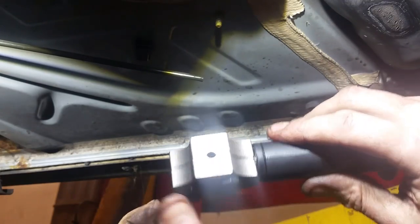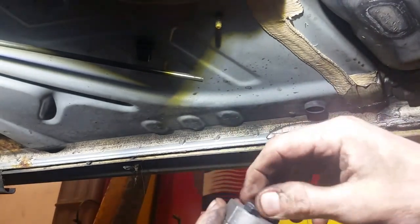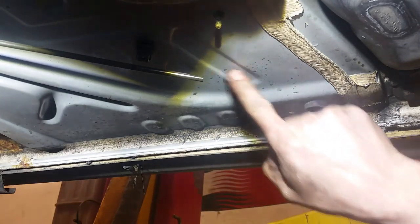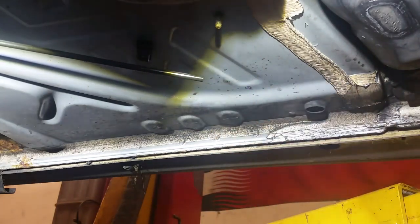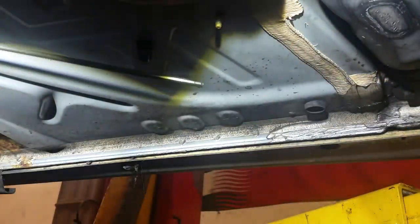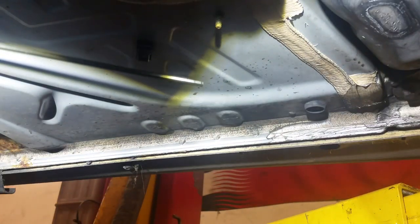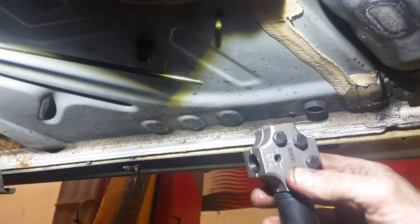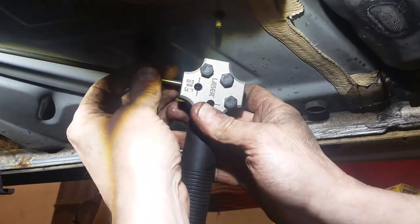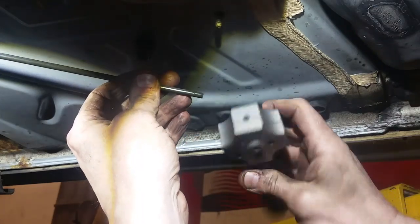So whenever I started flaring stuff, I was doing double flares and it wasn't fitting in these wee connectors very well, and I was having difficulties with it. So if you look inside that, that's concave, so that's like that in there. So what we want to do in this is what they call a bubble flare. And here's one thing you have to remember: get that up there right away, because you'll forget. Very easy to forget. So here's what we want to do. This wee boy here, handheld, doesn't take up a big lot of room. You need something pretty portable to flare, and you need something pretty good to flare a steel pipe.